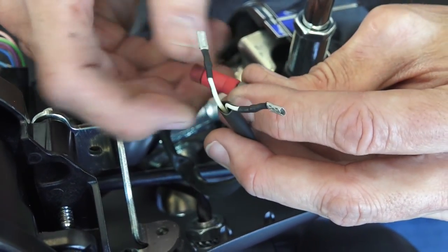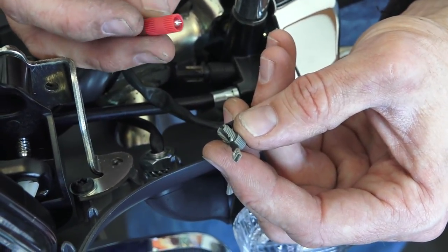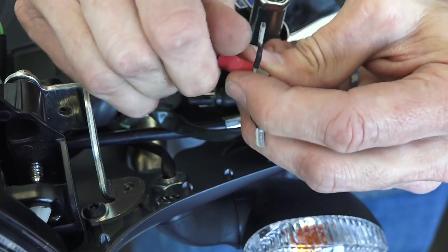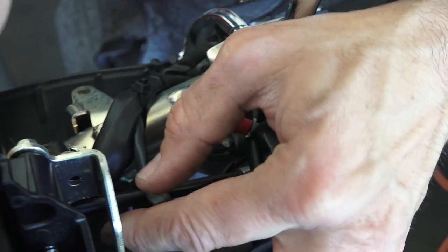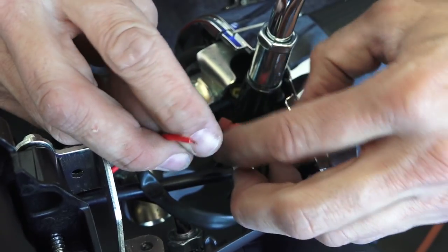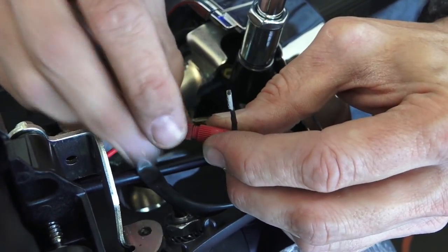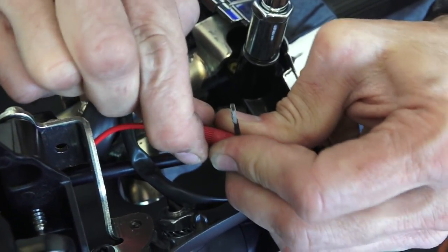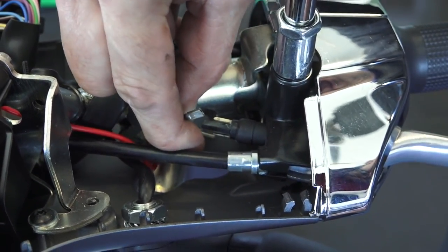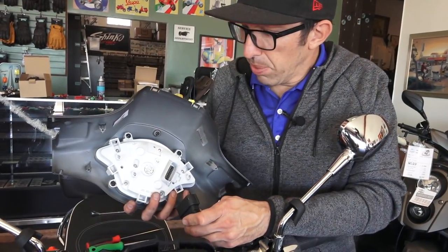There's a pair of wires coming off the brake light switch — one with a black stripe and one that's solid white. Locate the solid white wire; it doesn't matter what position they're in on the switch for brake light operation. Straddle the gray terminal of the posi-tap — you'll see the silver-plated needle that threads into the gray ferrule. Take the red wire, route it underneath the frame, twist the conductor strands, insert it into the ferrule, and tighten the red ferrule. Then reconnect the brake light switch.